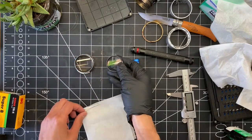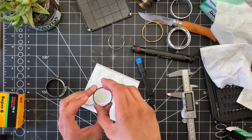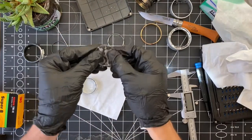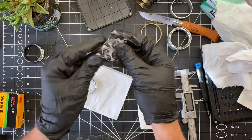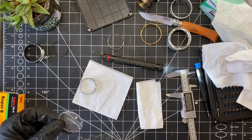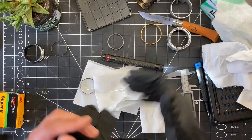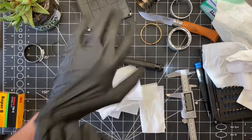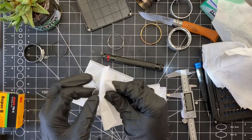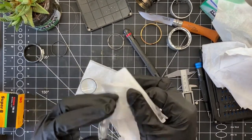With that off we can see the two different lenses: the outer lens and the inner lens. The lens actually had a lot of fungus on the inside and I really wasn't able to remove it with just Kim wipes and my breath. So I took both lenses to the sink and washed them with warm water and dish soap. This is really good for removing any biological debris left in the lens. Once washed, I dried them off and began buffing again with my breath to remove any little pieces of debris or streaks from the washing process.